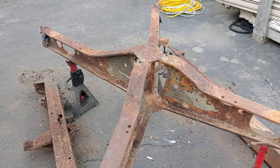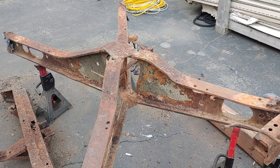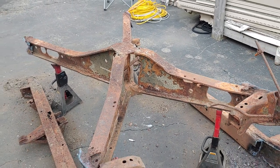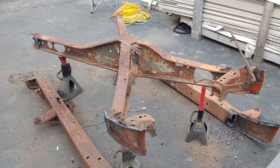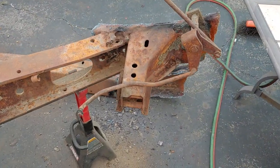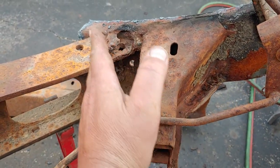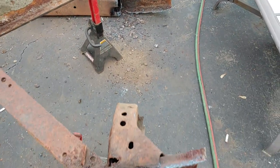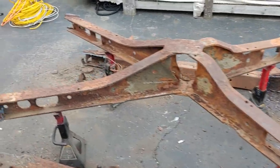A lot of people don't know you cannot get a transmission out of a tri-five convertible without pulling the motor. So they'll whack the X to give room for the tail shaft to slide out through one of the X's, and then they can get the tranny out. Another thing everybody mentions is that the transmission mounts and bell housing mounts are different — on a regular car it goes more towards an angle, it's not flat on the back. I've got a 55 convertible that I'm scavenging.